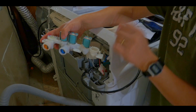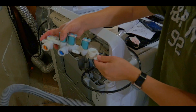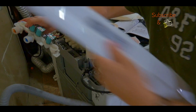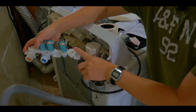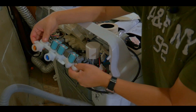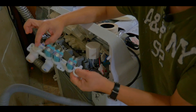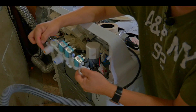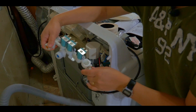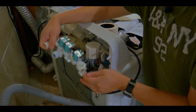Make sure you have the model number listed and that it corresponds to the parts you are trying to purchase. I'll purchase it on Amazon now. In the meantime I'm just going to put back this original broken piece — I'm not going to use the hot water. I'll plug it in completely, shut off the hot water hose, and just put in the cold water hose for now, since the part will come in about a week and I still want to use my washing machine.